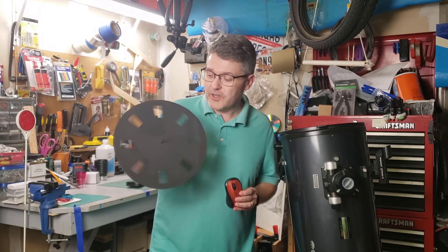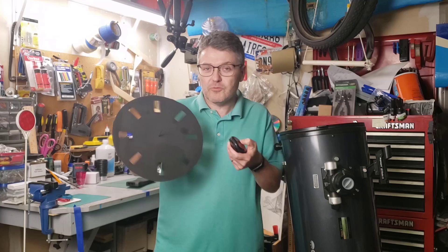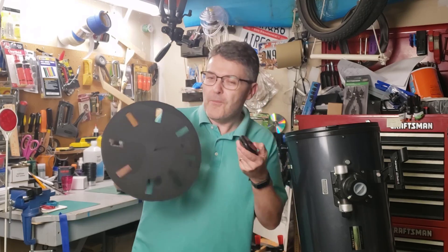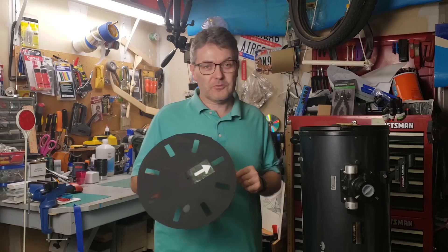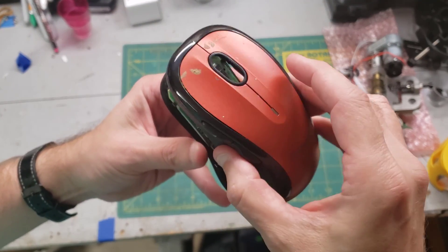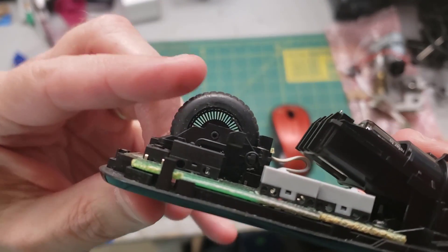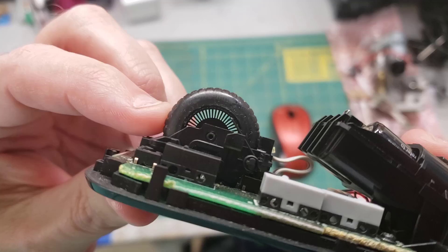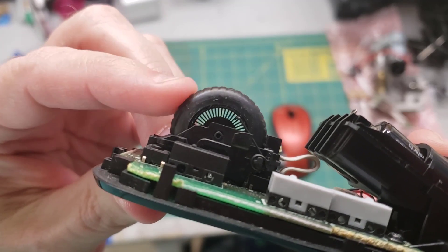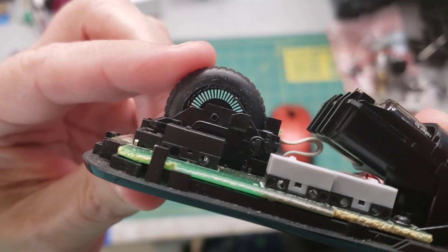Here's a giant encoder wheel that I made from a pizza box, and it simulates the one inside the mouse wheel — of course, the one in the mouse wheel is much smaller. Let's take a close look at the one inside the mouse wheel. Here's the wheel. Let's take the top off the mouse and zoom in on what's inside. Do you see all those little slots? That's a lot more than in my demonstration encoder wheel, but this one measures pretty fine movement.